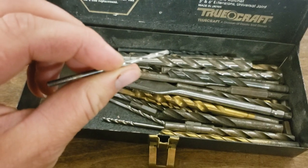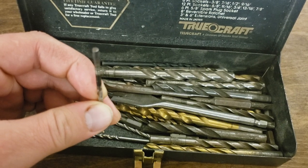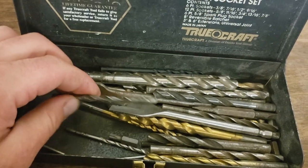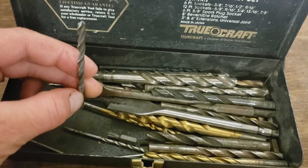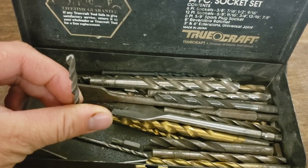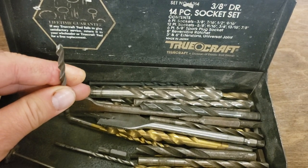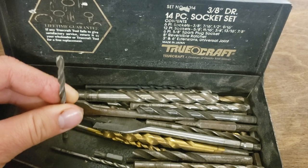What I did was take the smallest drill bit I had and drilled right in the center of the line going out — the clogged line with the restriction. I drilled right straight through that valve, then took a size bigger but still smaller than the diameter of the hole coming out, to widen it. On very low speed I drilled it out once more, blew it out with some brake cleaner, made sure there weren't any pieces in there, and also tested that I hadn't cracked anything while drilling.